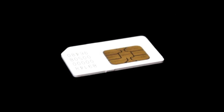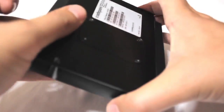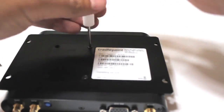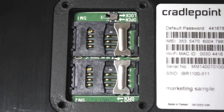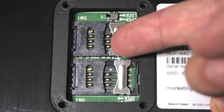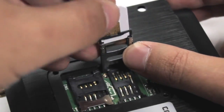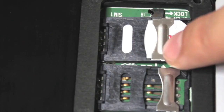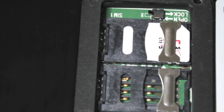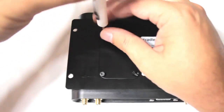Once you have activated the SIM card, grab a small Phillips screwdriver and start by removing the bottom SIM cover. Slide the metal latch down to unlock the SIM cartridge — use the cartridge marked SIM-1 first. Pull the cartridge upwards to a 90-degree angle, insert the SIM card with the metal contacts down and notch out, then press the cartridge back into place. Return the metal latch to the start position and replace the bottom SIM cover. Note that the device will not power on without the cover in place.